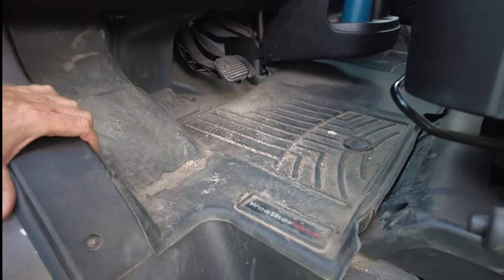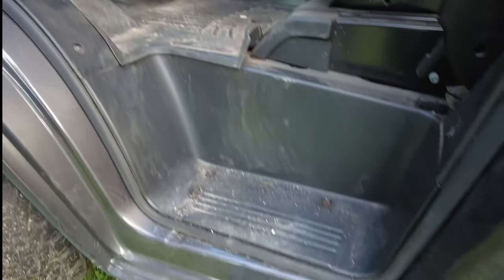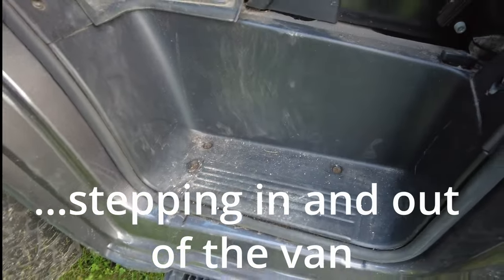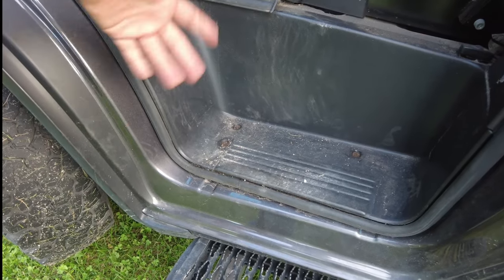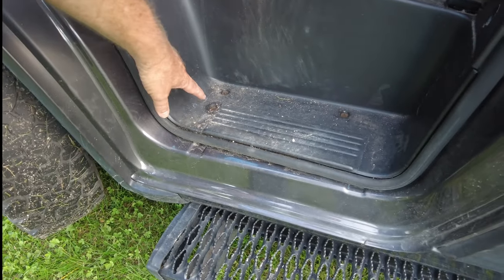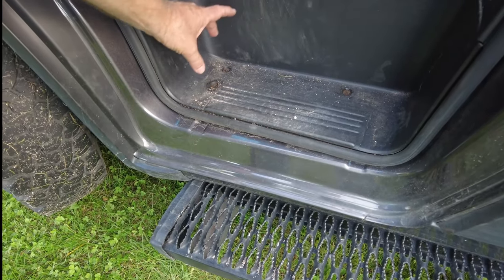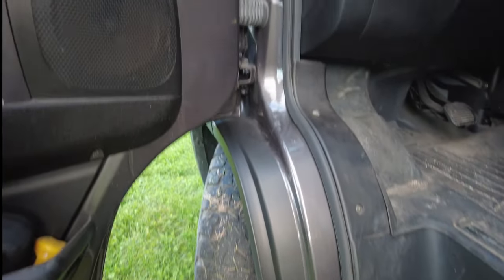You have to look at what kind of vehicle you've got and how these things are working. In my situation, if the water or snow gets in there, these three holes are screws holding that panel in. What I normally do is have a monthly routine of going around with WD-40 and spraying these. Even if the WD-40 sits in these cavities, they're always going down because they're going into the body. I'm trying to protect that from rotting, and then I do my hinges and things at the same time.